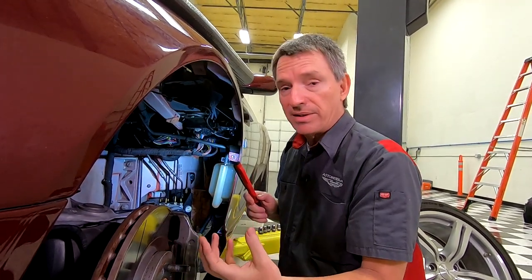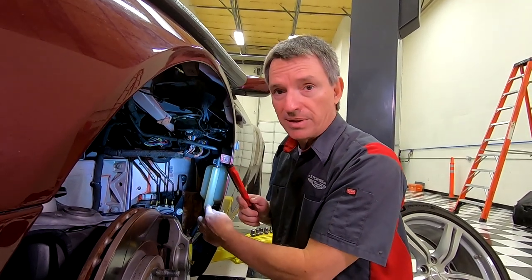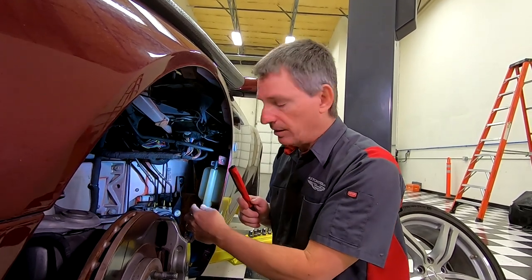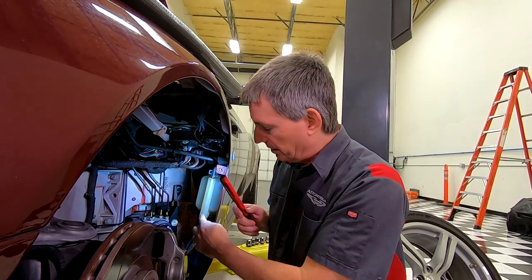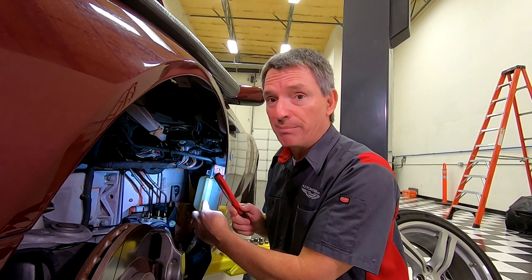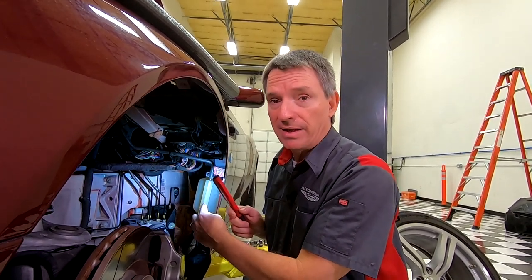You might actually see a little bit of cycling - if the car heats up, a little bit of fluid might come into here, but then as the coolant cools back down, it'll draw it back into the reservoir. So normally this tank should be empty. If you came in here and saw that this tank was half full, that's probably a sign of something bad going on in your engine, and you might want to get that looked at by an Aston Martin shop.